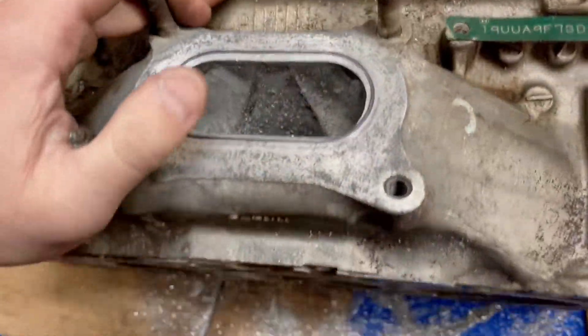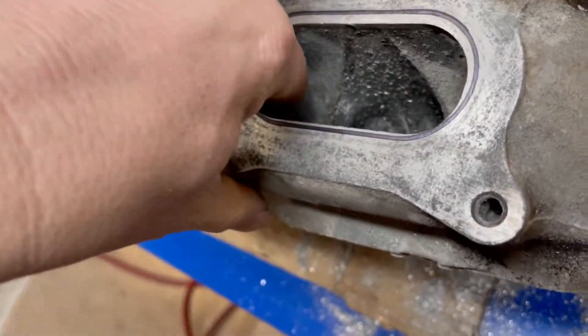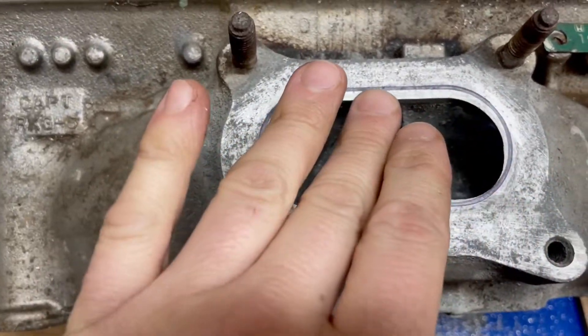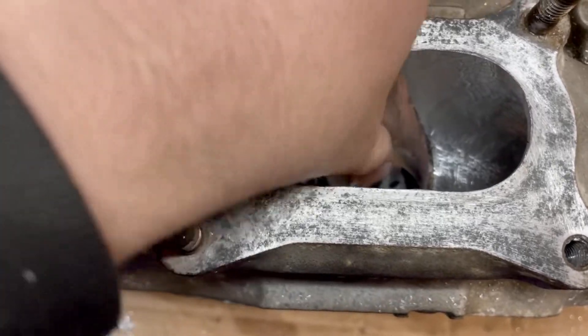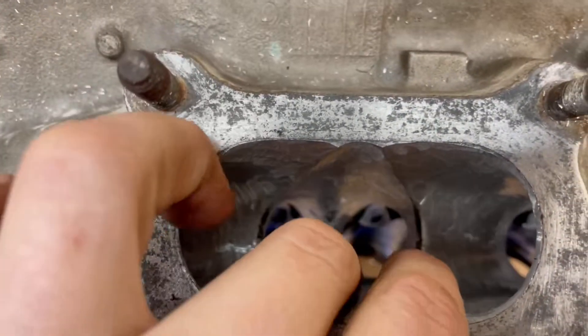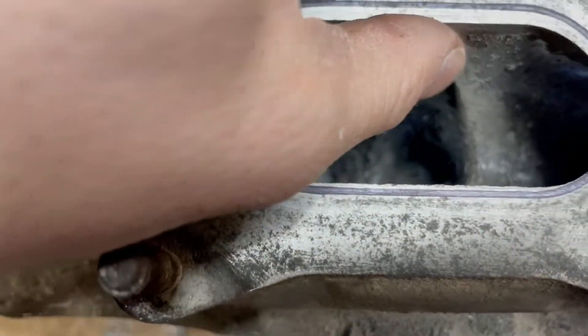This is the secondary, this is the back head. I've got the bowls all done, insides all done as much as I can, cleaned as much as I can. I'm gonna port this out and then start blending in, basically creating the same roof - keep the same texture, it's a little more aggressive than factory. Hopefully this will help channel the exhaust straighter. The factory one still has a ridge on it, not as sharp as mine, so we'll see if it works.